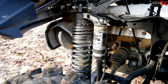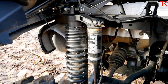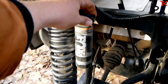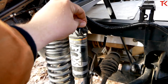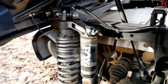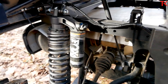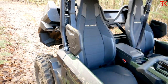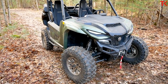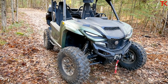While we're back here we can also take a look at the suspension, since you have such good access with the bed up. There are actually two different suspension setups you can get. We have these Fox Performance series shocks with a few adjustable settings using a quick switch — you get three positions to adjust your stiffness. In the rear of our two-seat model we have just over 16 inches of travel, while up front you have 14.2 inches of travel — a serious amount that's going to help swallow up obstacles on the trail. There is also a brand new on-the-fly adjustable shock available for the RMAX that you can adjust from a switch inside the cabin, but we don't have those on our model.